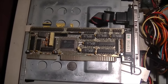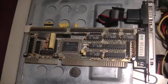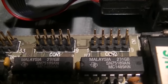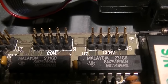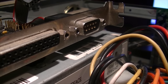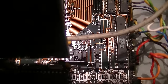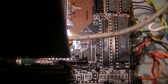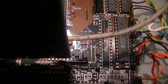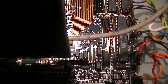This is the multi-IO card, and it was the one that came with my 386, not the one that was installed in there, though we did have it on loan until I find this one. Both serial ports use a header, so I'll be using the ones in the case. And as for the one on the back of the card, well, I could remove it, but I might actually wire that up to the CPU speed control jumpers and do some clever shit with relays so I don't have to have a control box plugged in, but if I do, I can adjust the clock from outside.